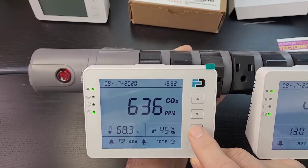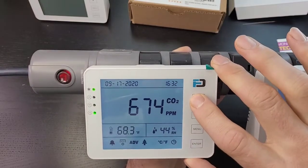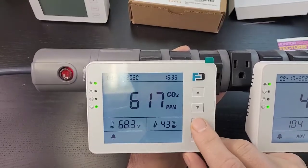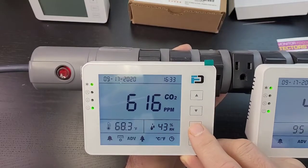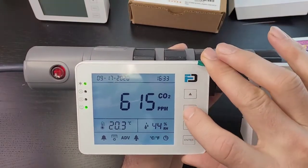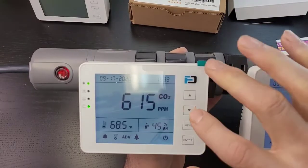Next in the menu is the pine-tree/up-arrow icon — that shows the maximum CO2 level the monitor has recorded since being turned on. To clear it, hold the up button for about four seconds and it clears. The max memory feature is useful for reporting high CO2 in a particular room. Next is the Celsius-to-Fahrenheit toggle for our friends in Europe. Remember: every time you navigate to a menu item, you must press enter to actually go into that sub-menu — you can't just scroll to it.